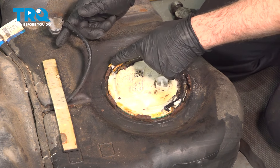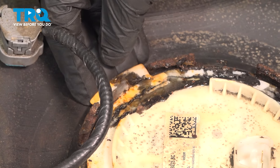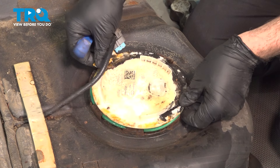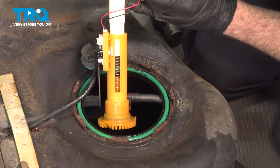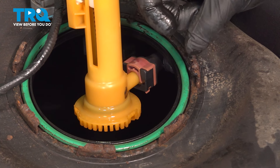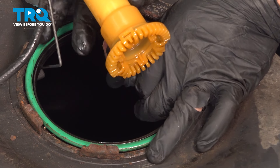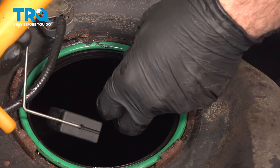Lift this up. There's an arrow on the tank itself — this large tab needs to be where that arrow is located. Go ahead and lift this unit up. Use a plastic trim tool to pop that up. Lift this unit up, and on the bottom side there is a hose with a red locking clip. On the bottom side there are two tabs — pinch those in and push up on that clip, then twist sideways to wiggle that hose off.